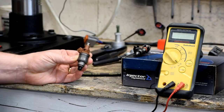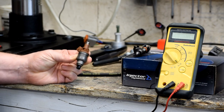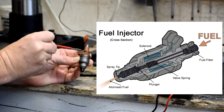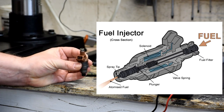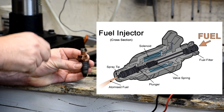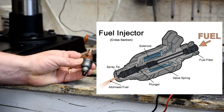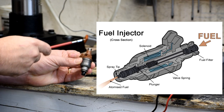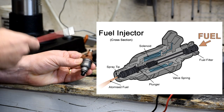A fuel injector is how an electronically controlled fuel injected car controls how much gasoline goes into the engine. It's an electromagnetic solenoid — inside the body are some electrical windings, here's the electrical connection. One end goes to positive 12 volts, the other end goes to the computer. When the computer wants to turn this on, it pulls one end to ground, completing the circuit and opening up the pintle. When the pintle is open, fuel comes in, pressurized to about 40 psi from the fuel pump. Fuel comes up through here and squirts out of the nozzle. When the computer decides to stop fueling, it brings the connection back up from ground, breaks the circuit, and a spring inside closes the pintle, shutting off the flow of fuel.